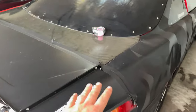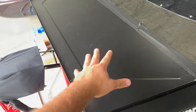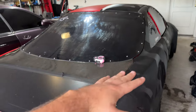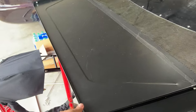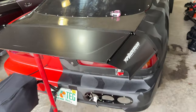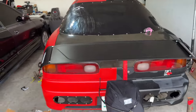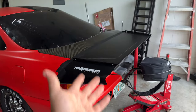The main benefits of having a wing is basically channeling the air passing the car to create turbulence — in this case with a wicker — to then allow downforce on one side of the wing and channel air straight on the other side. The air needs to create pressure and transfer it down through the wing hard-mounted to the chassis. If it's all flimsy, as soon as you have any air pressure the wing is just going to cave downwards and you lose the aerodynamic benefits. You see some people launch and the wing flaps or shifts up and down — it's just not ideal.